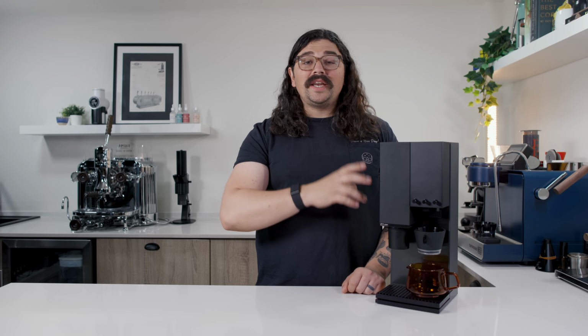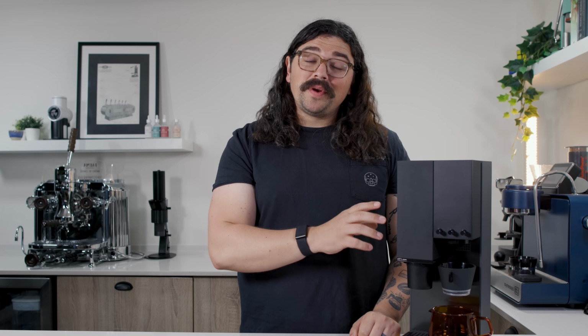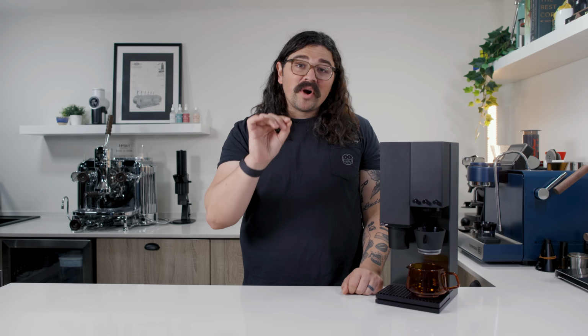We are able to get incredibly high torque, allowing us to introduce a new feature on this, which is espresso. Yes, it can do espresso, and in fact, it now has 80 different dialing points that you can play around with, all the way up to really coarse cold brew, all the way down to choking out a Weber unifilter basket on an espresso machine. Every single click accounts for 18.75 microns of vertical burr movement. That's important to understand. It's not burr gap.